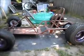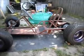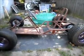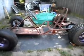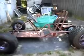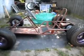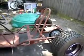We've already begun the cleanup. We'll do a series of videos outlining the various steps — from cleanup, to replacing the rear bearings and sprocket on the rear axle, to squaring up the front wheels, steering shaft, and replacing the tie rods. Then we'll get to installing the motor, controller, and everything else. We'll try to show you step by step how we accomplish this, then take a test drive and see how it all works together. Join us — it should be fun. In the next video we'll show how we replace the bearings on the rear axle.